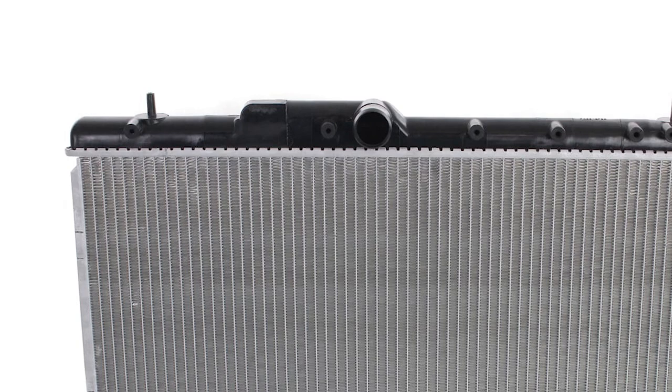The factory radiators, to this day, have plastic in-tanks that are just crimped on top of the center of the radiator. Back when the WRX had a radiator with no cap on it, there were a lot of radiator failures. If the car got warm, the fingers crimped to hold the top tank on would loosen up, start leaking, and the radiator had to be replaced. So my best guess is that Subaru put that cap on there just to relieve pressure if it got high enough to damage the core or top tank of the radiator — to prevent that damage so the cooling system would continue to function.